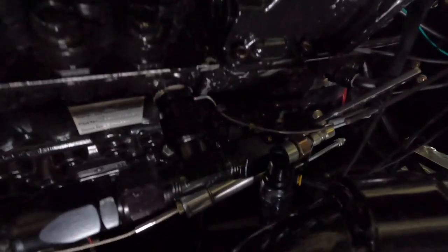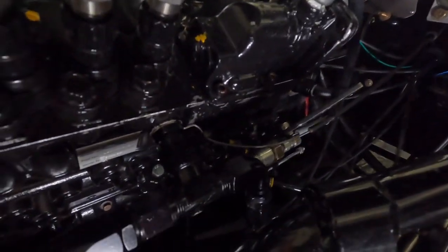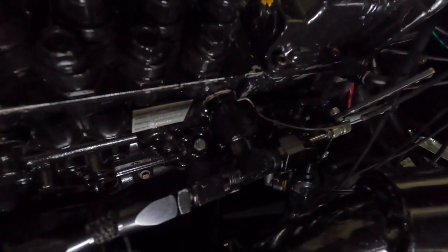We're back to full range of travel. Now, because I don't use a bump box to stage — if you had a bump box you can just wire this into your trans brake button so it operates exactly as shown. But I am staging with the foot brake, rolling in, and setting the trans brake. I have an input on the smart wire that goes to my brake pressure. Go back to wide open throttle and hit the foot brake at the same time — see, that also makes the staging limiter. You can spool up, flat foot it, roll in with the brake, set the trans brake, and when you let off the trans brake and the brake, it goes right back to wide open throttle down track.